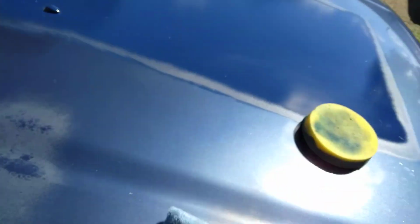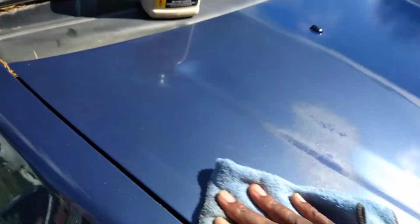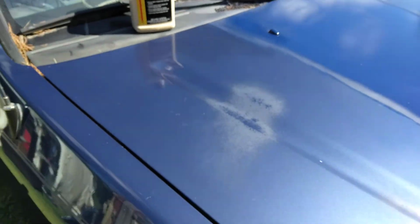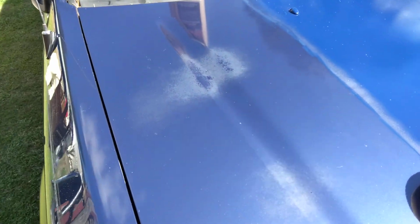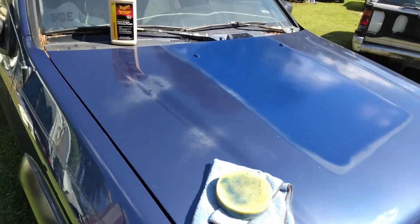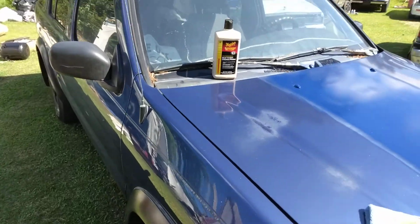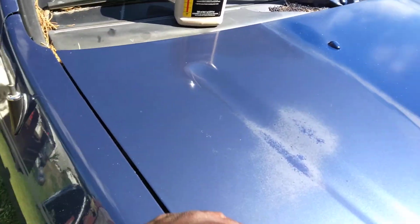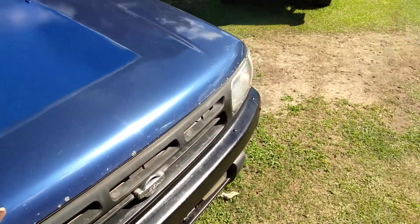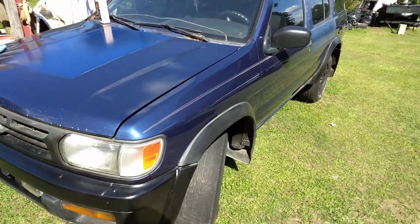Alright. See, a lot of people think a miracle's in a bottle. A miracle's not in a bottle, y'all. I mean, it is what it is. Some stuff, look at it, you still can see it pretty good. Some stuff is too far gone. I ain't gonna cap to you. It's best to just take this whole hood, get the color code off the truck, sand that whole hood down and shoot it.